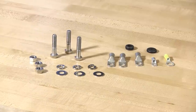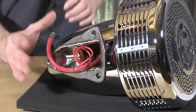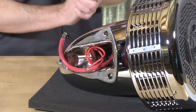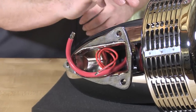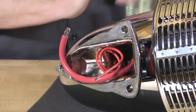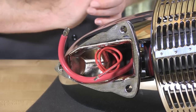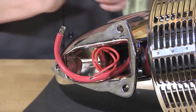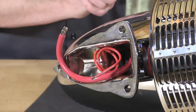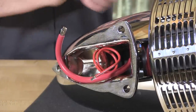Using the appropriate hardware included with the Q2B and following the specific details in the install guide, the pedestal mount is where this will affix onto your vehicle's front bumper or appropriate mounting surface. Nicely tucked up and in, routing into the mechanical electro system all inside this, which has the worry-free clutch assembly. The connection for the main power is a four gauge wire, so this way it has appropriate inbound power. The other trigger wire ties into your siren and lighting control panel.